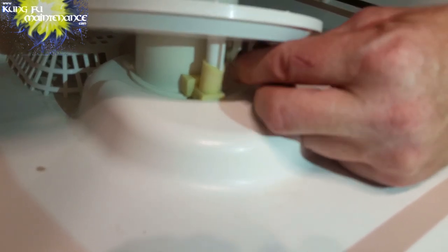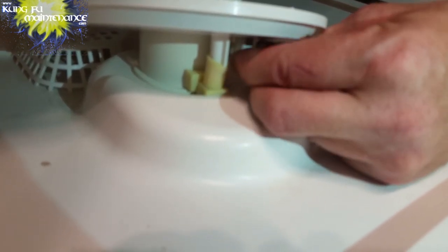This is one thing definitely to watch for when you're taking it apart. It's very easy to not realize that that little screw is there and break it. So before you start taking this apart, you've got to know that it has the front screw here and the back release clip here. Not my favorite design for sure. I like the older stuff, but it didn't have all this newer check valves and all that. But nothing wrong with it. It's a good thing, but it'll be a little annoying.